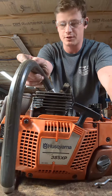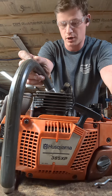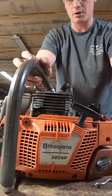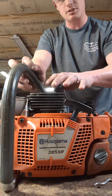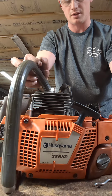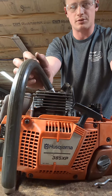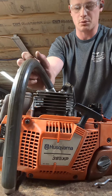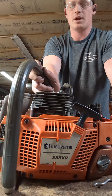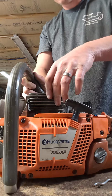This one was featured in a video yesterday doing the short block, doing new crank bearings, new crank seals, reinstalling the crank. Today I did the port work. I should have taken better pictures. There was a bunch of chipping and debris damage in the band from where the old crank let go. That was all gone after 20 thousandths of a cut. Went ahead and did a 45 thousandths cut because we were there. Set the squish back down to 20, put some basic work numbers. I think they're like 80, 98, 120, something like that.